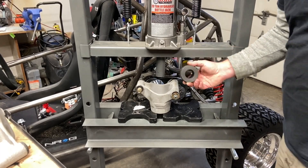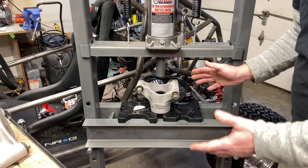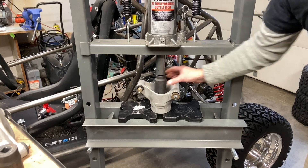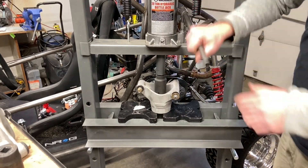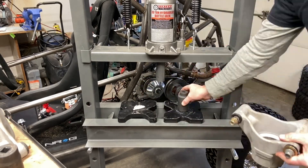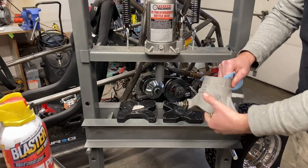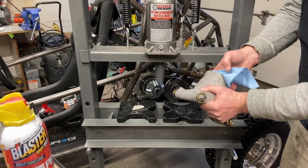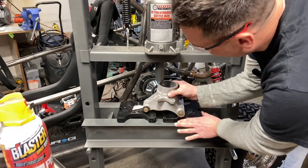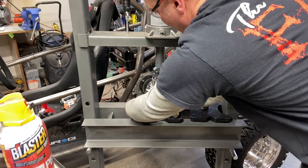The secret to pressing things isn't too cosmic — you want to get something flat or a similar shape to the bearing. Pressing out bearings isn't a big deal; they can separate all they want. When you press back in, you can use the old bearing. Sockets are kind of my go-to for that. Press this old bearing out — look at that, came right out too easy. Give it a good cleaning. If it's old and there's some rust in there, use a little bit of sandpaper. These are really nice hubs, so set it up making sure it presses straight.